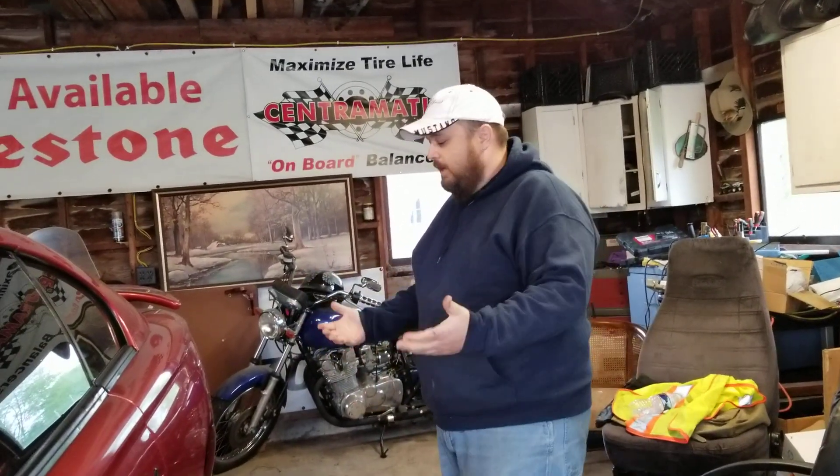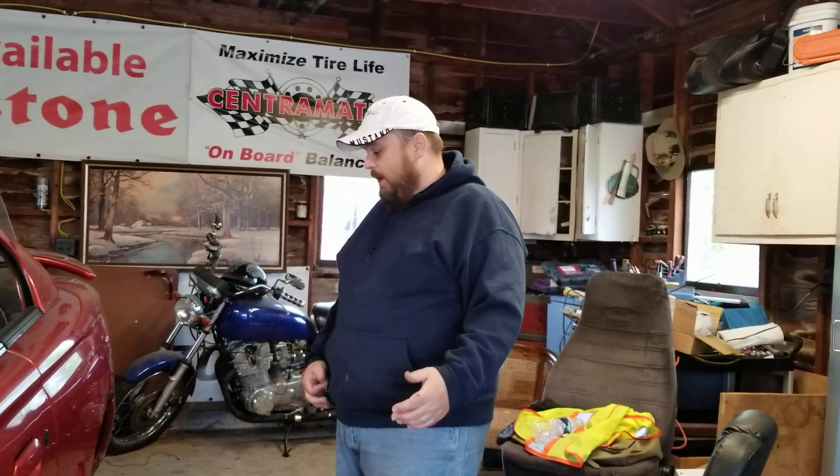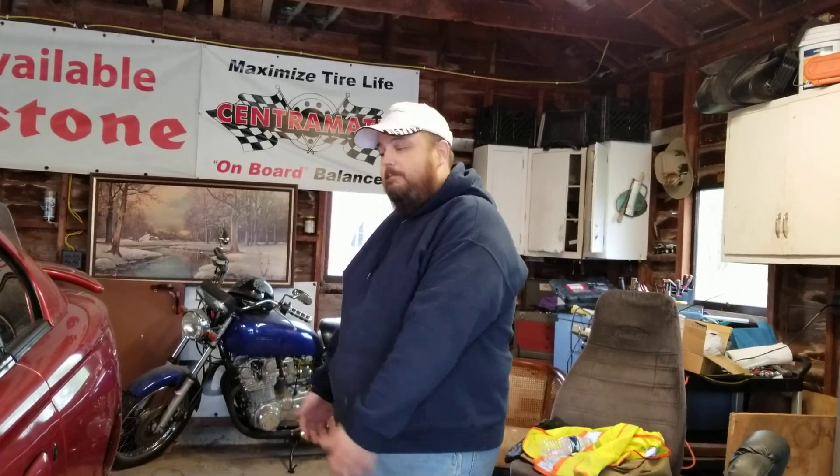Back on the Mustang, we're slowly getting it done. Hopefully in the next couple of months I should be driving the Mustang for the first time ever — I basically just drove it home and then had to park it for the past year because I had no time and no money to fix the brakes. There's also a little bit of engine stuff to do, just basic stuff from it sitting — hoses that are dry rotted. When a car sits for a while, you've got to go through all the rubbers and change them out if they look dry rotted.